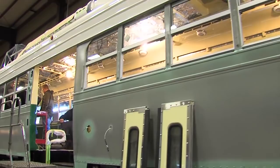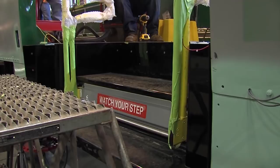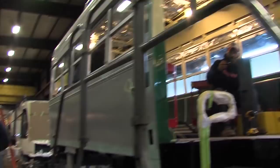You can see the wheelchair lift is actually installed and it deploys — it comes out from the stepwell down to either curb height or street height. There's a bit exposed here, but we just have some roof paneling to put in. The panels have already been installed once and are now over in paint to be painted, then installed a second time. We did the fit-up, made sure everything fits correctly, and then they went over to be painted for final installation.